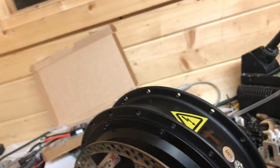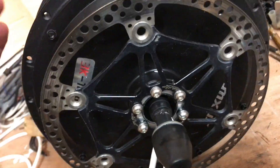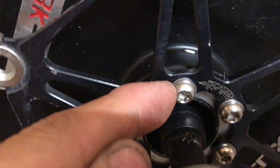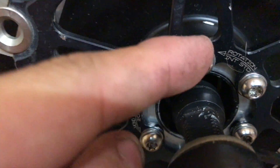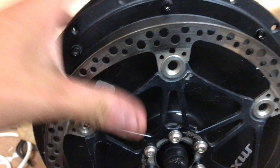The caliper, which is this bit, won't fit on the disc with enough clearance between the side of the caliper and the motor, usually. So what you need to do is buy some spacers, which are those little aluminium bits down there, and some extra-long disc brake bolts. These are actually too long, so I had to put some extra washers on there, but that's on there now and it works.